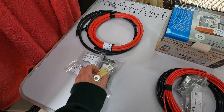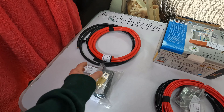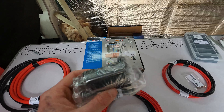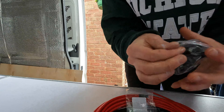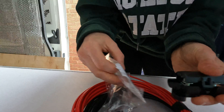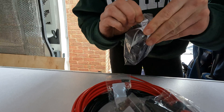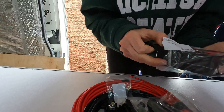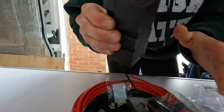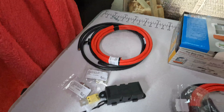I think the 100 amp fuse is a little bit overkill — I didn't know whether I should have done an 80 amp. But because of the size of my cable, they recommended not to go any smaller. I couldn't get a midi fuse — which is slightly smaller, where your wires go in and the fuse goes in the middle — because my cable wouldn't fit in one of those. The mega fuses only came in 100 amp minimum, so that's why I've ended up with a 100 amp fuse to go between my fuse box and batteries. I also have a kill switch in there.